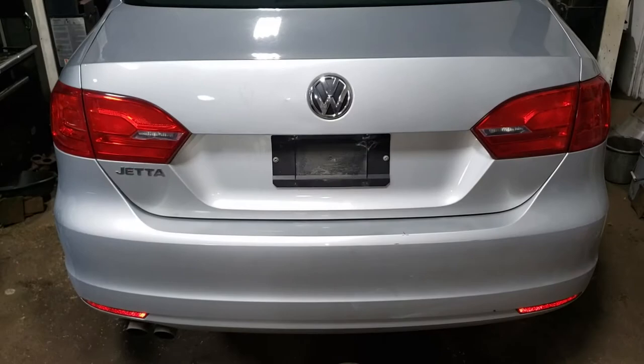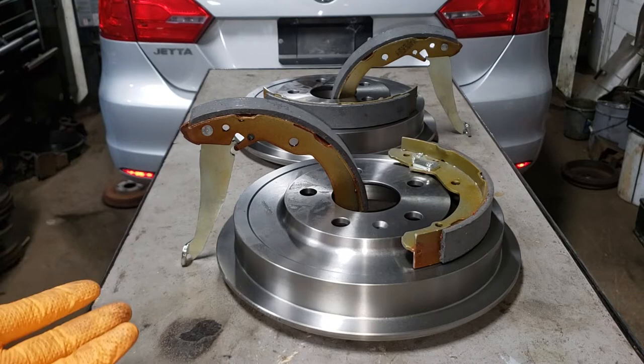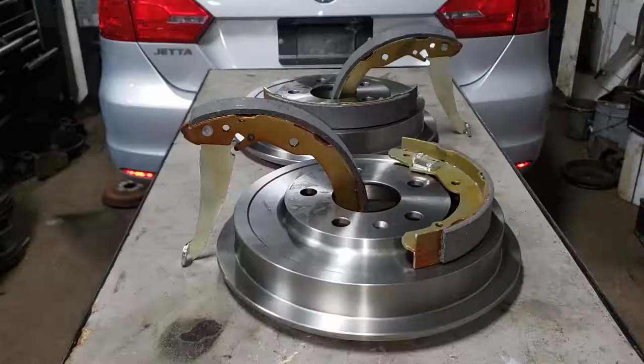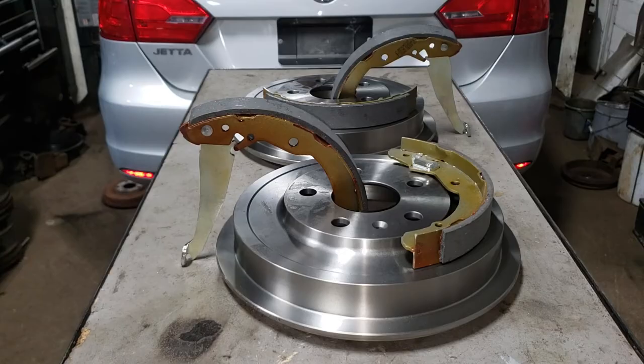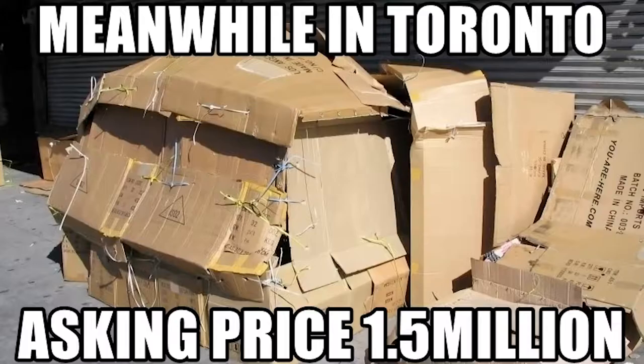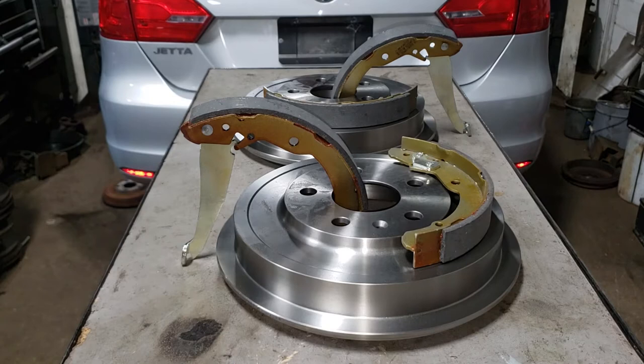Before I get started, do me a favor and hit that subscribe button. To most of you young mechanics, you probably have never worked on this sort of stuff. This is a drum and this is a shoe. This used to be common practice for most manufacturers throughout the world on the rear of most vehicles about 20 to 30 years ago, and further back they were also front brakes. The drums are a terrible option — generally reliable and long-lasting but a pain to service. They are cheap, which is why most manufacturers used this setup. Unfortunately, because they aren't really used anymore, I found out yesterday when trying to source these parts how expensive they are locally and how much of a pain it is to find them. It would actually be cheaper if the vehicle had rotors and pads in the rear.